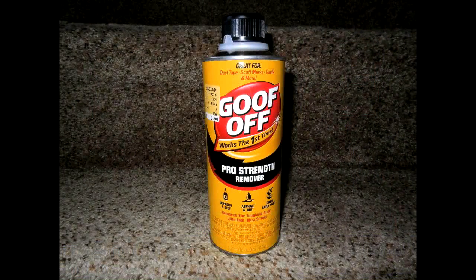They're not going to be sucking in a lot of grease if they're not directly above the hood vent, so you should be okay. There is that Goof Off product — Infinite Gary uses it sometimes on gear because he's got his setup in the kitchen, a similar situation. But I would find some place that's never going to be seen and test it first. You'd want to spray a little bit onto a cloth and dab it — because Goof Off will take glue off of things, and there is glue holding the perimeter of the tweeter and the driver to the rest of the speaker. You'd have to be so careful. I would never put Goof Off on there.